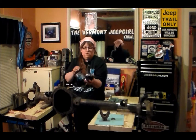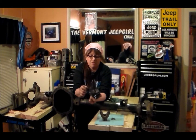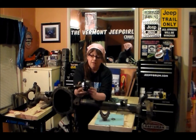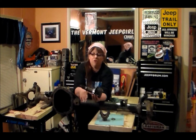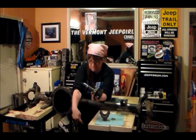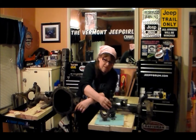Here's our pinion. A little bit about our pinion: there's a bearing — this is our inner bearing that spins around. This little metal round piece you see here is an oil slinger. And then the bottom of the pinion, we have teeth. Now these teeth are the ones that mesh with the ring gear when the driveshaft is spinning — this spins, spinning the ring gear. That's how that works.